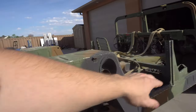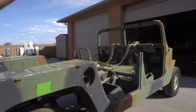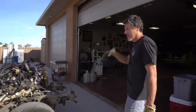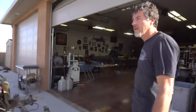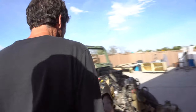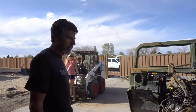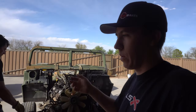What we did earlier is throw a measuring tape on here, find center of the wheel well and center of the wheel, so he knows where it has to sit — and that extra stuff has to go away. Same with the front, which also picks up where the engine's at. You could slide the body forward more toward the center of the engine, sure, but your wheelbase would be way off. To keep the wheelbase correct — which is the part he figured out — the Hummer was 130-inch wheelbase, the Suburban was 130. So the wheelbase is correct to begin with and you have somewhere to start.